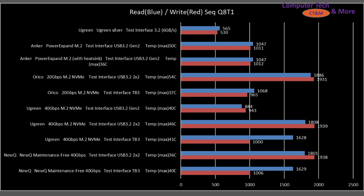So it's either a problem with the laptop in that its only implementation is at 20 gigabit per second, because Thunderbolt 3 allowed it to run at either 20 or 40. It wasn't specified or locked in to that higher speed like Thunderbolt 4 is. Or it's a problem with the device. And again, I just don't really know which one it is, and I have no way to test it. So that is the caveat that we're basically looking at right here.